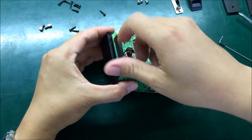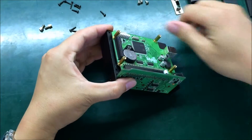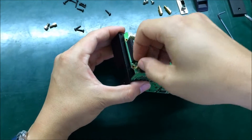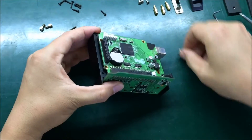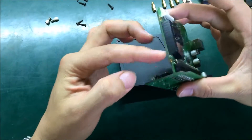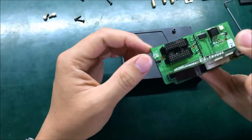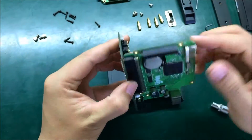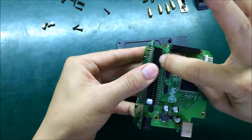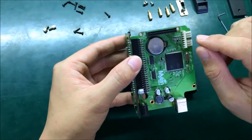One, two, three, and four — so we open here. Then we remove the sensor. You can see the sensor here — you need to be careful with the sensor, do not knock it on the center housing. This is very sensitive. Now, to separate this one — on some new models of the printer, this is already proven very tight, so you cannot remove it easily.